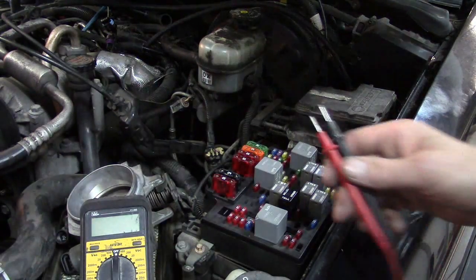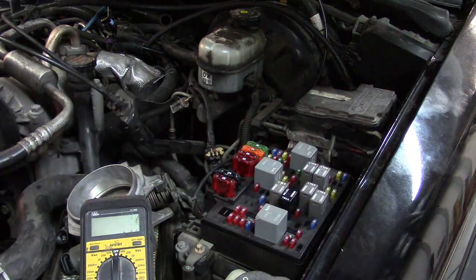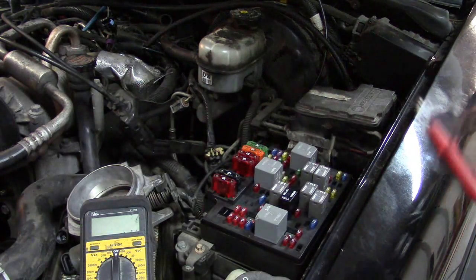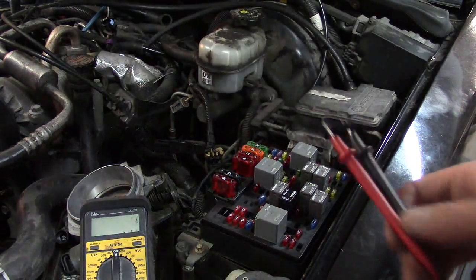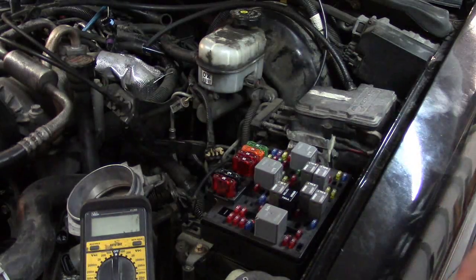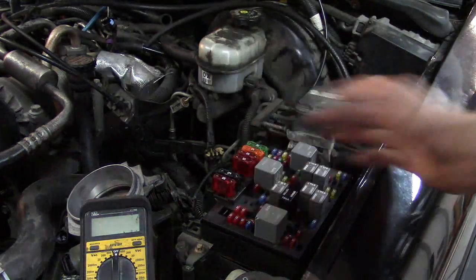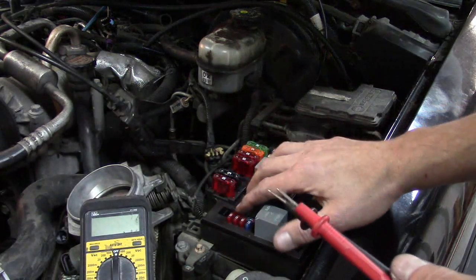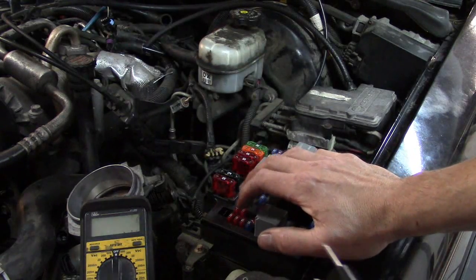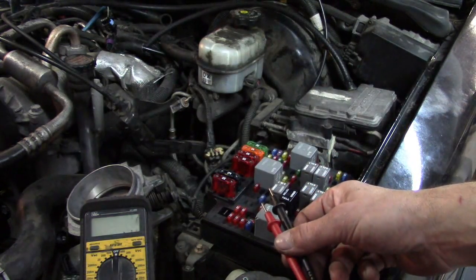This method basically takes advantage of voltage drop. If you're not familiar with the concept, click the link in the description to see my video on voltage drop. If you understand voltage drop, it should be obvious that most fuses are on the positive side of the circuit — while there will be voltage there, there will not be current through most of these fuses. If there is no current, we cannot have voltage drop. If any fuse actually has current going through it, there will be some voltage drop — even a minimal amount through the fuse — and we're just going to do a voltage drop measurement to detect that.